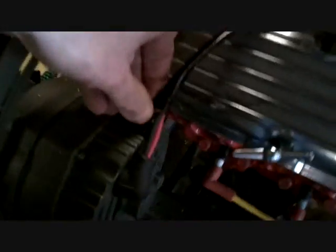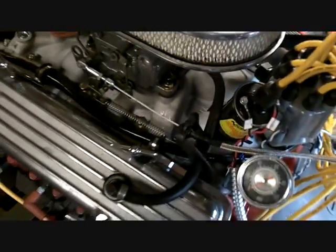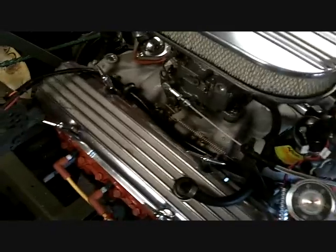The alternator. You cannot wire, what the hell was I thinking? I just read it the other day. All right, all these leads are correct now. Everything's going right. That's number one, goes over to the coil. Was it the coil? No, number one. These two go to the battery, aka the starter. One just does a loop and goes to here. This one goes up orange wire in, and it's got the diode. Then it turns to the blue and white, which I figured what the hell, we'll use them both. And that's on the coil. I don't know if that'll work. I've seen it online, it was in a drawing, but you never know.